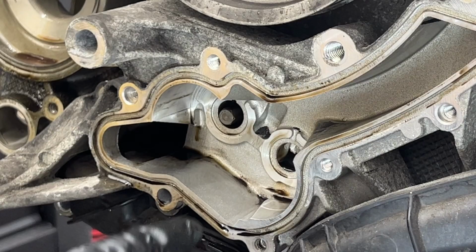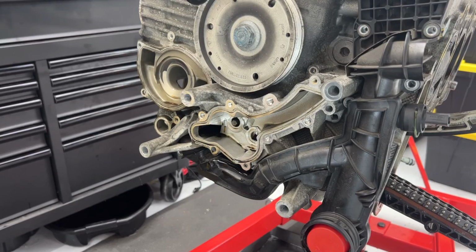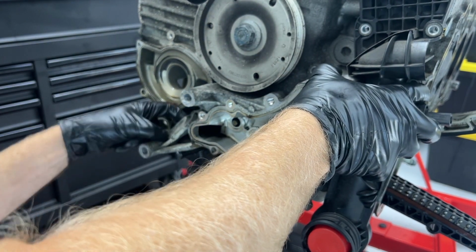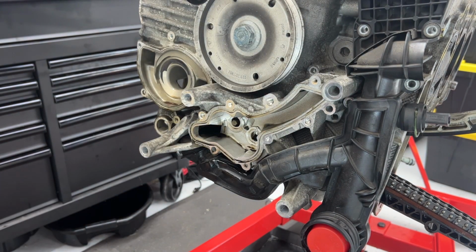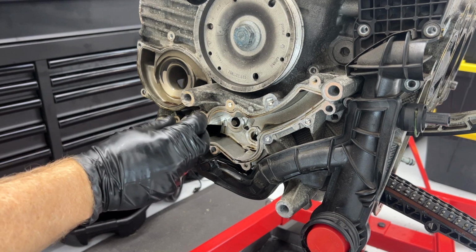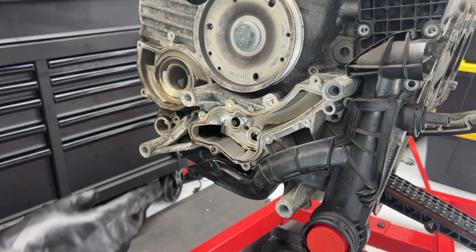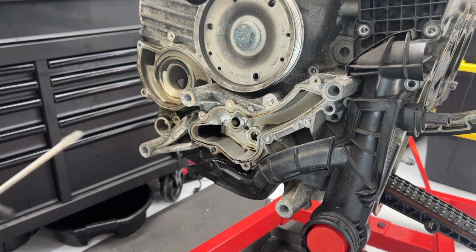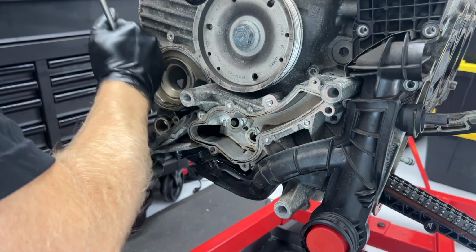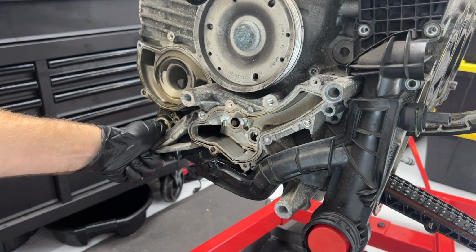So I guess you want to remove this plate and the internals first before removing the other bolts around the console. Okay, everything else should be disconnected now, but there is a bearing, essentially a fixed bearing that the intermediate shaft is resting on and riding around. So it's going to have to come straight out. So this piece is rotating around that bearing.